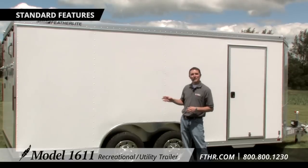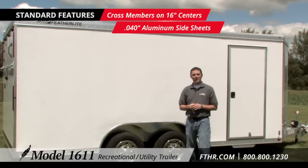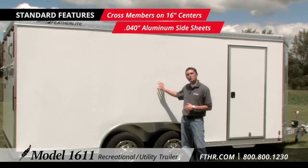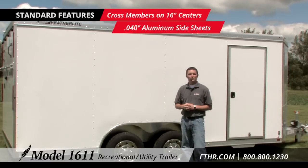The 1611 is going to feature cross members on 16-inch centers. You're also going to notice it's got .040 side sheets. You're going to want to be careful when shopping the competition. They tend to stretch their cross members or go with thinner side sheets such as .030. This can cause problems later on with the trailer, buckling side sheets, structural damage, and so on.